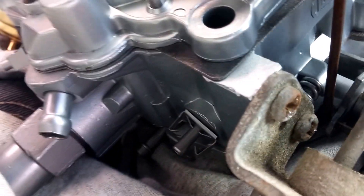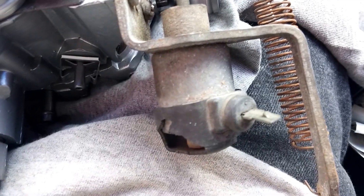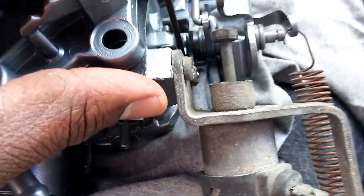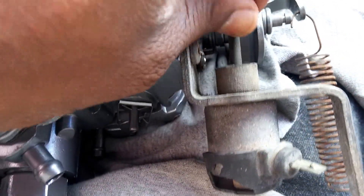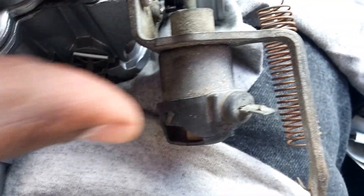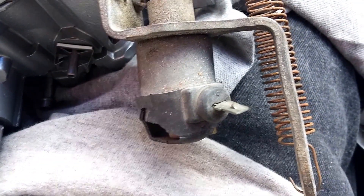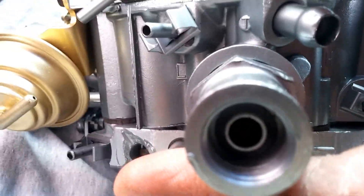By doing it this way, he had it powder coated and sandblasted all the way down to the metal. Look at that — that's a Q-Jet. They also have my factory solenoid for the air conditioning. He said it does actually work; when you put some power to it, it actually clicks. Most cars I see with the carburetor, that solenoid doesn't even work and people have to adjust the hell out of it to make it run right. He also put a new filter on it.